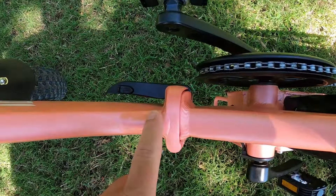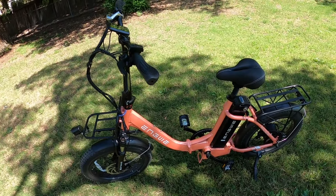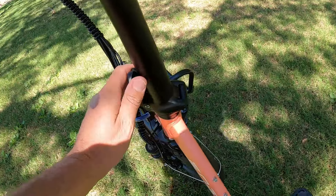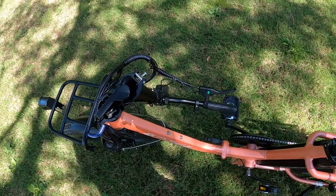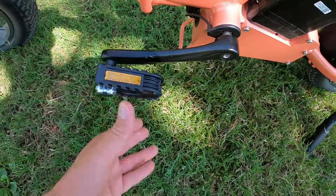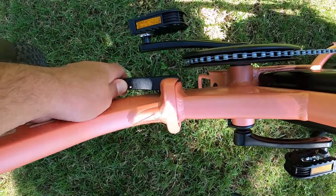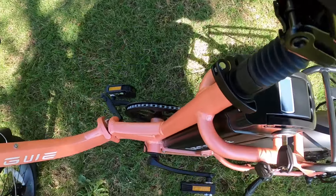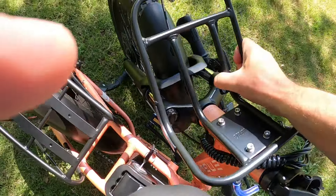That's part of the folding process along with the frame and taking the handlebars down. Now I'm going to show you how to fold this bike up and what it looks like when it's completely folded down. First, turn the bike off. Then you pull this lever here and simply fold this down — really easy. So that handlebar goes down like that. Then for the pedals, like I said, you just pull that little bar in on them and they fold in together to make it nice and thin. Then the final step is to make sure the pedals are out of the way, come and unlatch this right here, move that latch open, support the back of the bike, and bring it around.